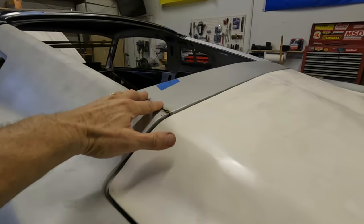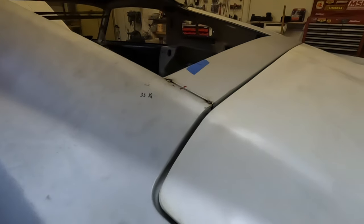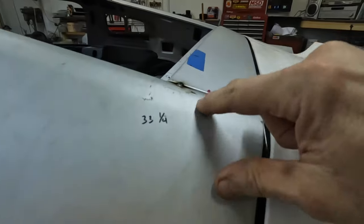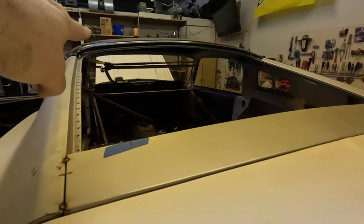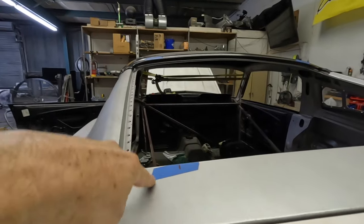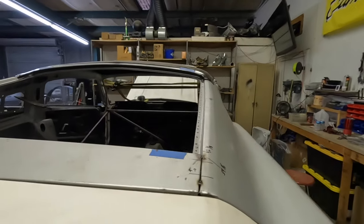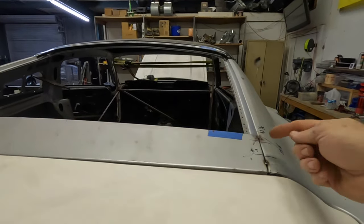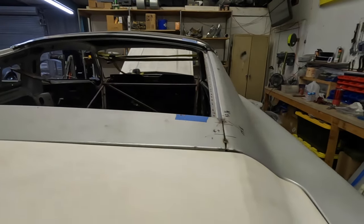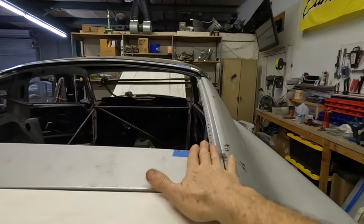This side fit very well with the gap, and you can see I have it tack welded now. You'll see a lot of lines and marks all over the car — I do these to make sure things line back up. I've got lines here to correspond with lines up there, measuring to make sure I'm getting consistent measurements. The trunk — I've got my lines here and there measured out to make sure I'm getting consistent measurements. I think this was four inches out. That gives my measurement to make sure this is sitting square.